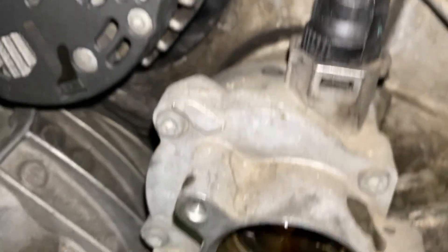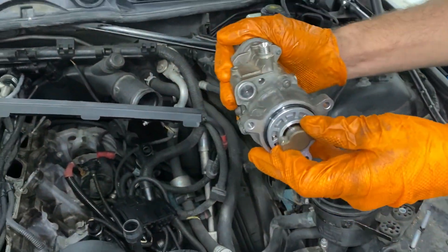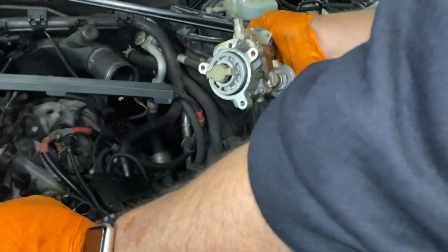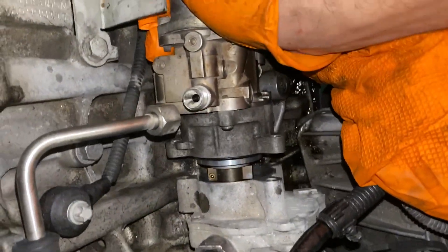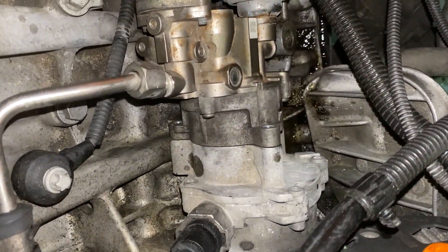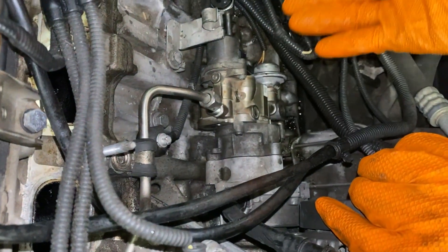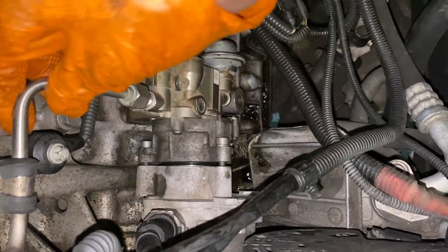You just have to line up your new high pressure fuel pump — approximately right over there — and make sure you've got a good seal. I'm going to reuse the stock seal because I don't trust that green one from what I think was the eBay pump. Simply reverse the procedures, line it back up, and put the three bolts back in, the lines back in, and so on. Then we put that bolt back in — pretty much reverse all the steps.